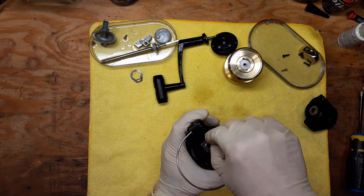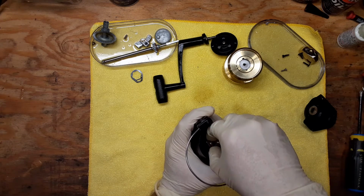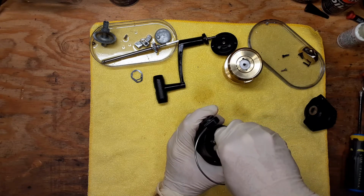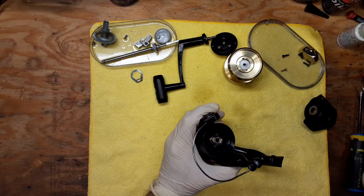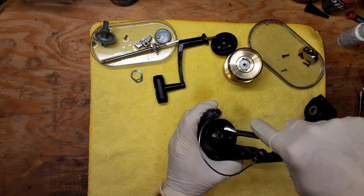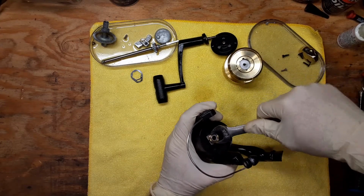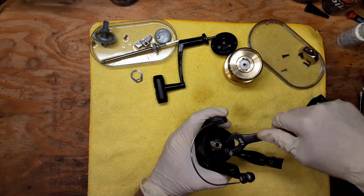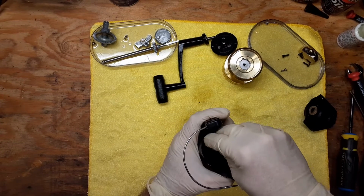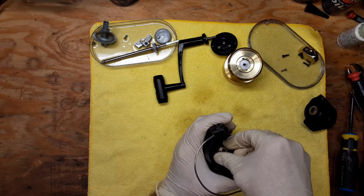And then we've got our rotor nut, and I don't believe this is a reverse thread. This happens to be a 9/16 nut here, so if you've got a 9/16 wrench like what I'm using, you can use that. You can use a socket, like a deep socket. You don't want to over torque this, okay, but it needs to be tight enough. And then we've got a capture ring here, a security ring, and this prevents it from moving.